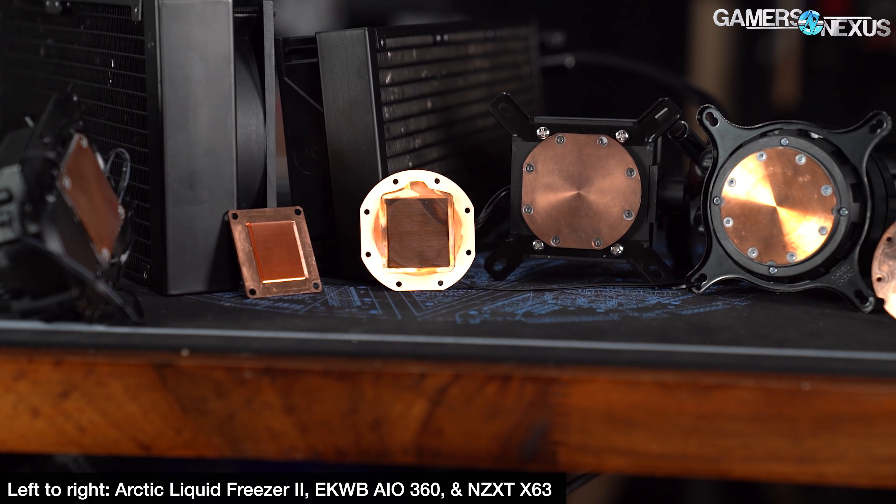The springs mean no concern about mounting pressure — just tighten within reason until sufficient resistance is provided, and you will be stopped by the springs. This helps standardize the mounting force and therefore the performance, but also reduces the risk of users over-tightening, as can happen with a lot of other products, Asetek included, where you'll just grind the metal off if you keep going. It's an easy enough process, and it's the same between Intel and AMD, although obviously with some spacing changes. HEDT parts cut down to just the four standoff screws without the need of a backplate.